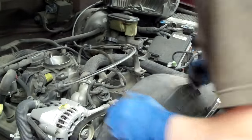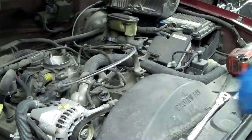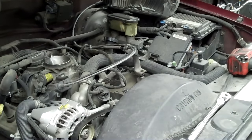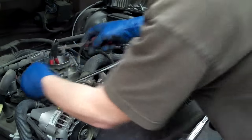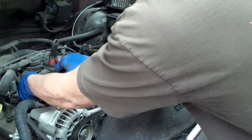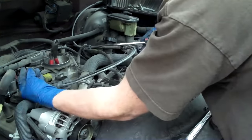The next thing you want to do is take your same screwdriver and pull this forward. I'm going to stick a rubber-coated pair of pliers in that to get a little slack in two places. Then I take this cable here for the cruise control and just pop it forward, and then you can pop these out.